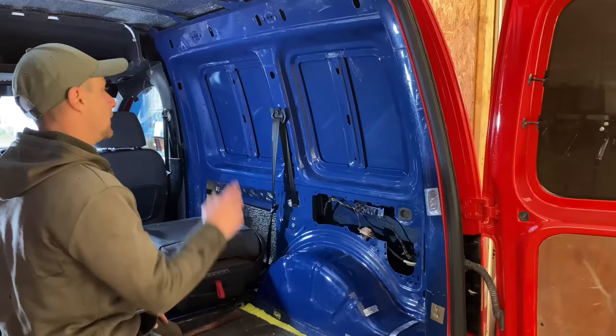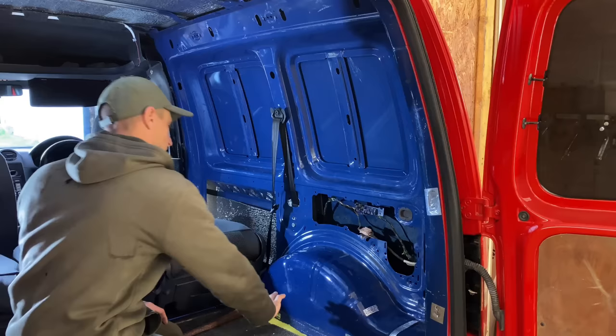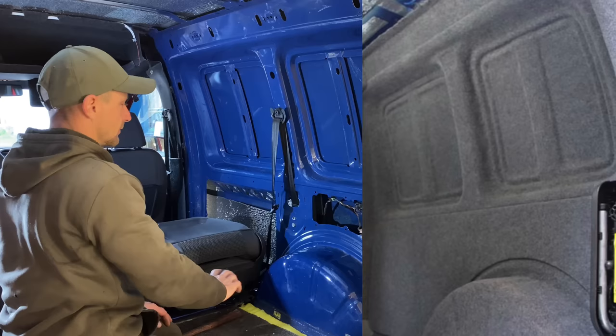We've moved into the van — you can see it's a bare panel van. It did have wood boarding in it which might have made it a bit quieter, but it was no good. There are three methods you could do this. The first one is just carpet-lining everything: literally cut two meters by two meters, spray-glue the hell out of it, and then carefully push all the carpet into all the creases and corners.